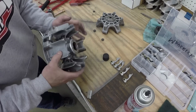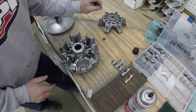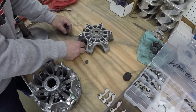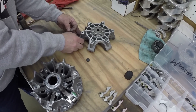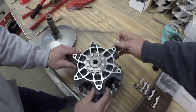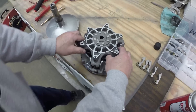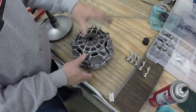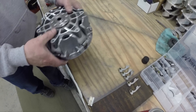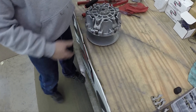For the primary, this might be a little tricky — it's best to have two people. The buttons can fall out, and there's an O-ring behind the button, so make sure you get them all in place with the right side sticking out. You basically have to line it all up. Especially if you're putting new O-rings in, it will be a lot tighter fit. Once you've got it together, hold it so it doesn't fall apart, stick this half on, and we're pretty much done with the primary until we go to put it back in the machine.